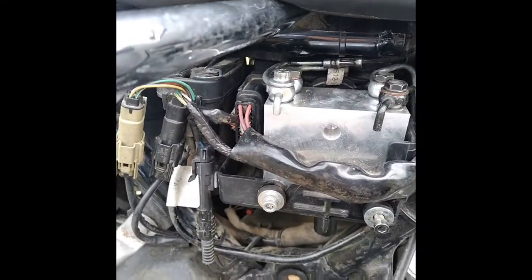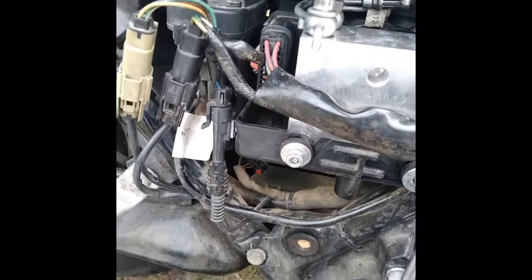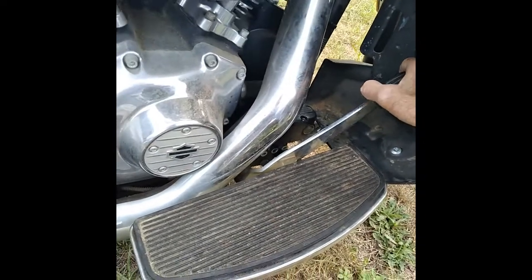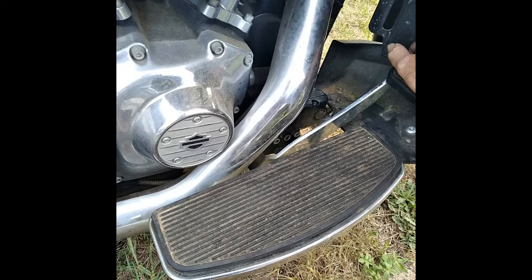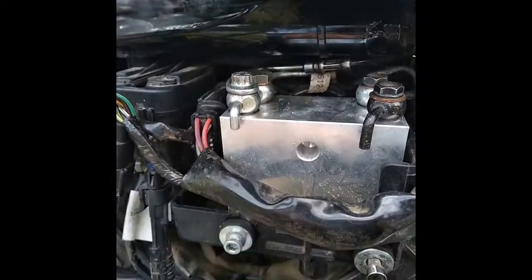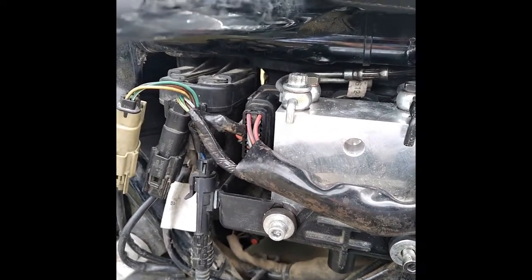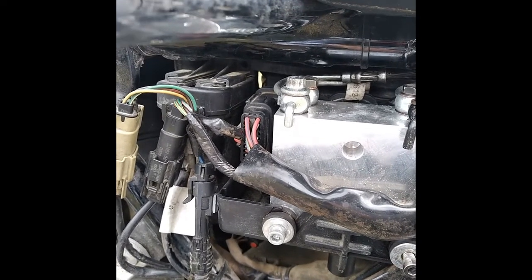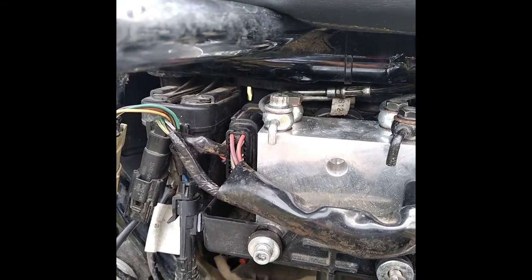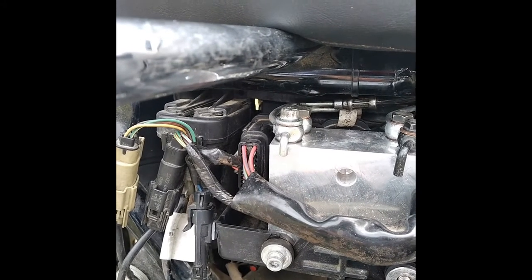I finally got the customer who bought the ABS block to replace — the one where the valves were stuck in. The front brake worked, but the rear brake: you'd hit it and it'd go down and then lock at a certain position, so the brake basically didn't work. The valves in the valve body were stuck — the valve body's right here under the right side cover. Harley in their infinite wisdom neglected to mention strongly that the brake fluid needs to be changed every two years, which is kind of strange because nobody else changes their brake fluid that much in the ABS unit.